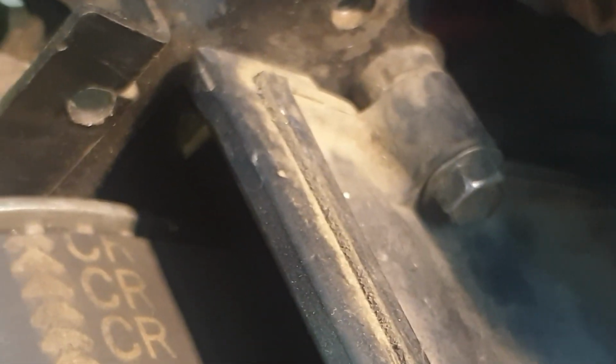And this time, there's the mark at the front. That's good. There is a mark at the back. Maybe I could whip that out, eh? We'll whip that out and I can just pull that out of the way and we can see down in there better. But there's the mark at the back, showing there, and there's a little dit, a little notch in that pulley there. You can see, look, that one's saying it's the crank there, but it isn't.